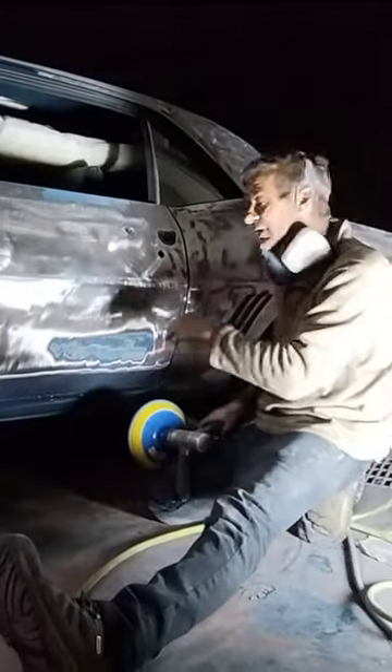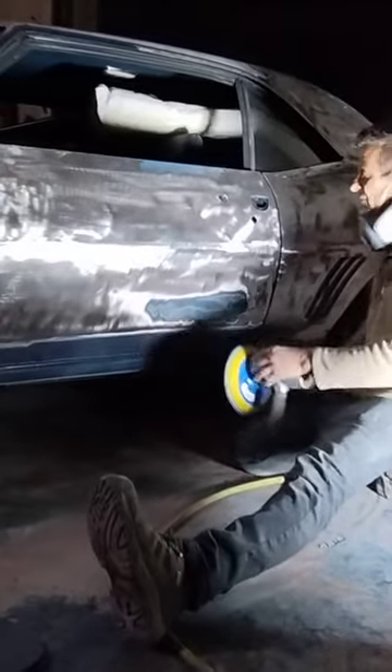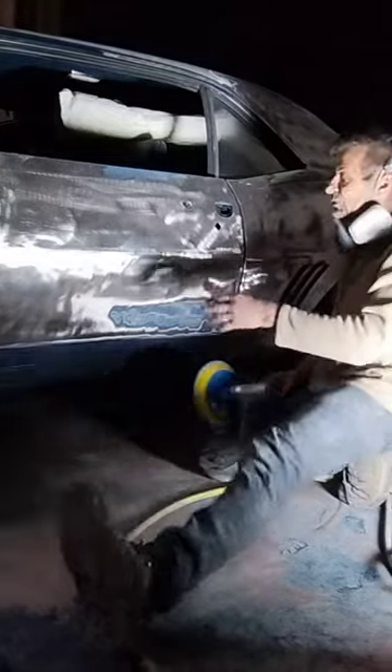You can't stay too long in one spot or you'll end up warping it. This is pretty solid metal so it takes a long time to warp it. But this is 36 grit at 5,000 RPM — rips off that old paint.